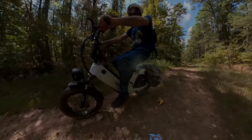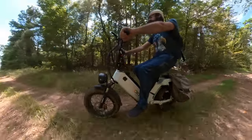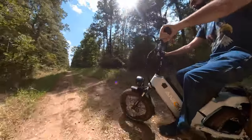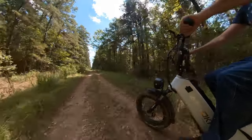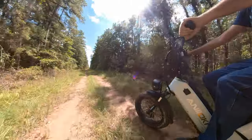One note and small nitpick about the headlight: under rough road conditions, it does tend to bobble around a bit. Not enough to really impact stability, just to kind of be annoying. It's mounted to a large soft metal bracket. I have no concerns about this bracket breaking, but it has to be soft because that's the only way you can adjust the headlight's position. You need to bend it down a little bit so you're not blinding oncoming traffic. So I'd say it's functional and safe, but has room for improvement.